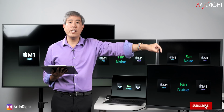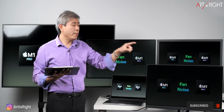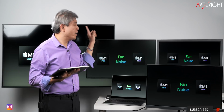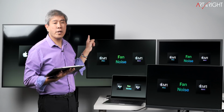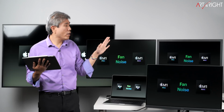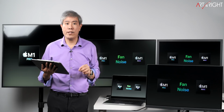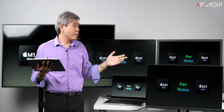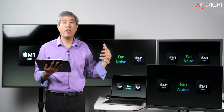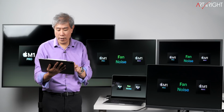This display up front here, the SW271, is linked up using an HDMI cable, and the BenQ SL 55-inch display back there is linked up using a DisplayPort to USB Type-C connection. So you can see they are all running at 4K and I can scale the resolution differently, and they're all running at 60 Hz. So no issues connecting external displays, and also I've run calibration on external displays, both software and hardware calibrated displays, and there are no issues whatsoever.